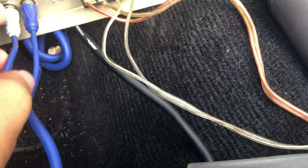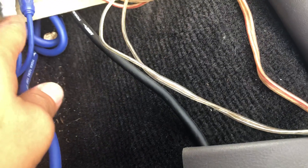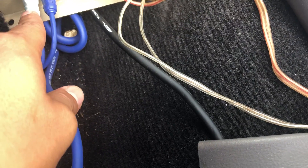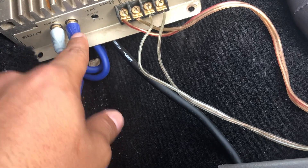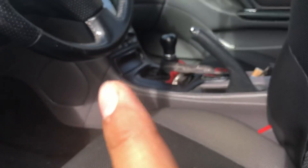So you've got your amplifier, and these are your RCA cables which connect to the back of the stereo — the red and white cables. I believe that's the white one and that's the red one. You're gonna take these cables and find a way to run them through somewhere. I ran mine through the center console — it's not the greatest wire tucking but they go to the back of your stereo.